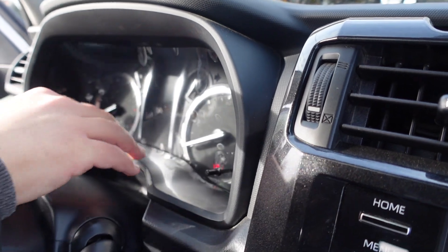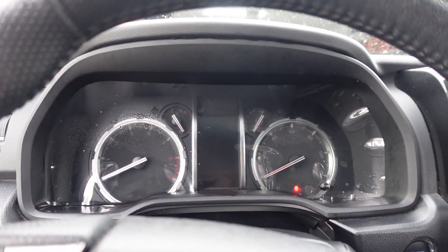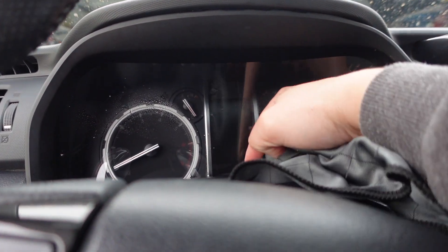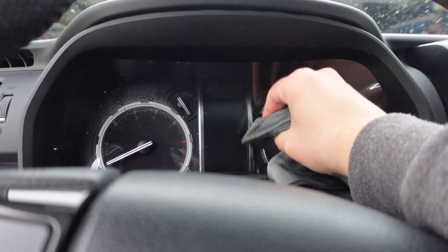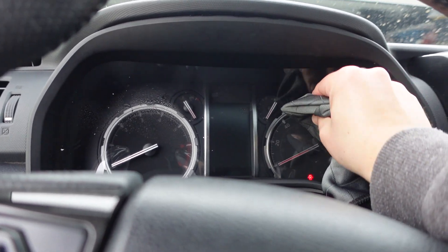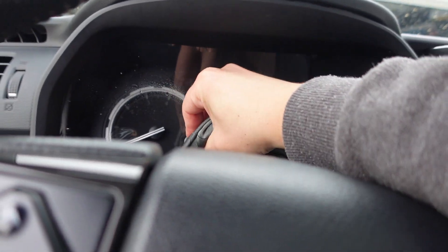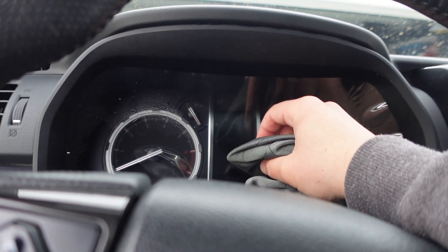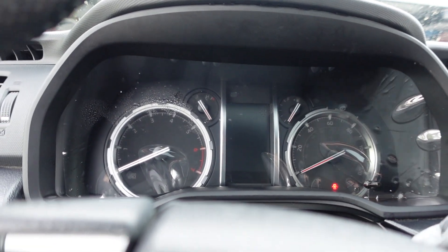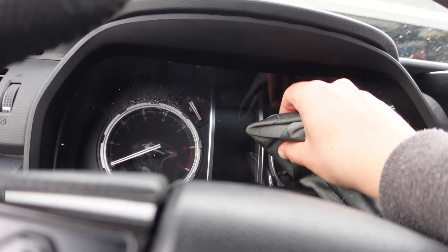I'm going to skip ahead on camera. Curved surfaces are very hard — you have to keep in mind that you'll be tucking in the top and bottom. They recommend wrapping the squeegee around a cloth so when liquid comes out from the edges the cloth absorbs it. Just keep going up and down. Being that it's curved, you may have to lift up a corner and re-smooth it back out — that's just the nature of vinyl and paint protection film on curved surfaces.